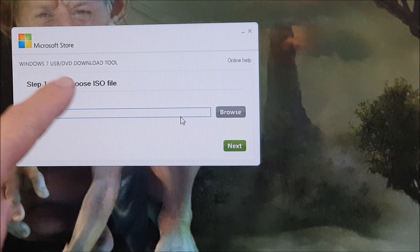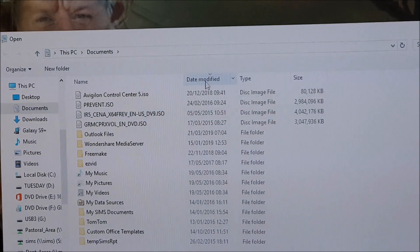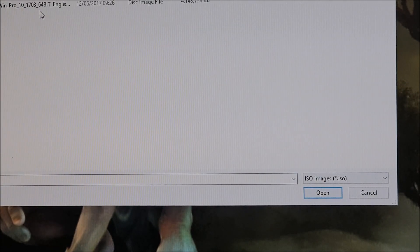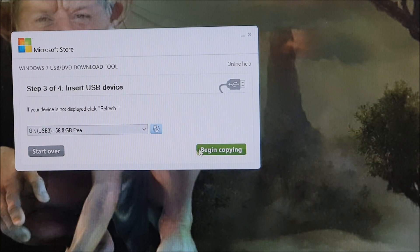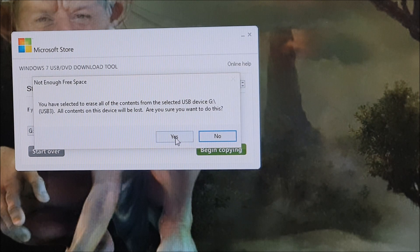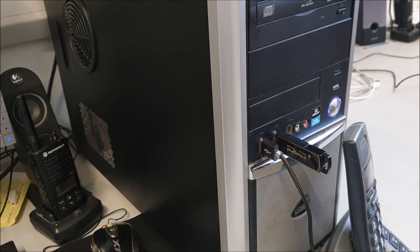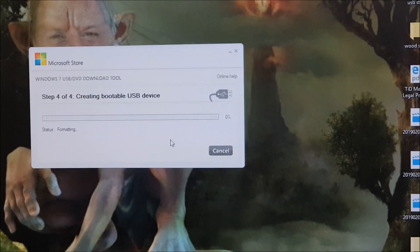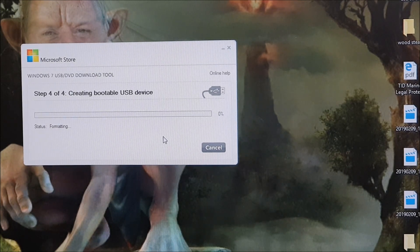On my PC I have a Microsoft Windows 7 DVD Download Tool. Because we have multiple licenses, I go to Browse, then Downloads, and I can select Windows 10 32-bit or 64-bit. I click Windows 10 32-bit, go Next — it automatically associates with the USB device. Click Next, Begin Copying, Erase — yes. I've put a USB device in my machine. It'll format that and when it's ready the screen will change — it's formatting at the moment. It's a 64 gig stick; it only puts what it needs on and makes it bootable.